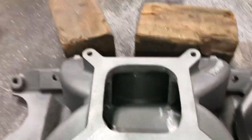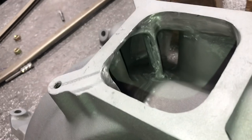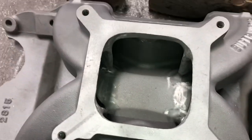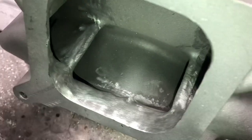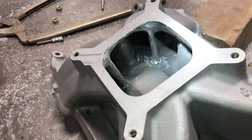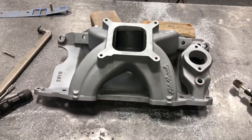I said I wasn't going to go too crazy on the upper plenum — well that turned into a lie. I got in there and the more I took away the more I could see better results. I cleaned out all this material, rolled everything down inside, got rid of the flashing on the bottom. I didn't take anything out of the dividers — a lot of guys knife-edge those but I've seen mixed results. We took a ton of material out. Look at the drop down now. I'll do a comparison on a stock one after. These transitions I'm really happy with. I'm going to sandblast everything so it has a uniform finish, and you can see down in there I tried to get rid of as much casting flash as I could.